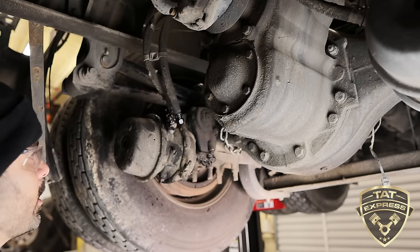So once you get this measurement, cage bolt off, I get my measurement, I'm going to go ahead and measure it off the new one. And this is where you're going to cut your push rod. You can mark it with whatever you like, a paint marker. And on these new clevises, you want to go ahead and buy new clevises.